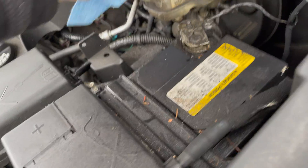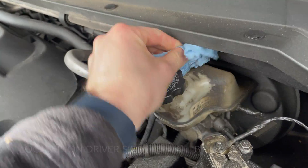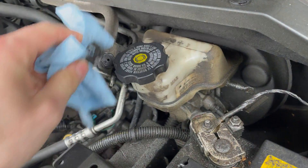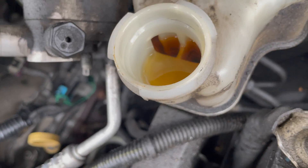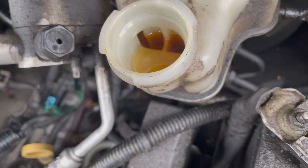Pop the hood, find your brake master cylinder — should be right here. Give it a little wipe, especially if you've got it oil sprayed like I have; it's gonna be real dirty. You want to be able to see the level. Let's see how the fluid looks — that actually looks pretty good, a little dark but not bad. So instead of pushing all the bad fluid through, we are going to get the fluid sucker out, suck it down, put some new fluid in, and start going.